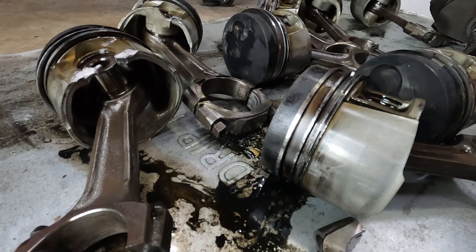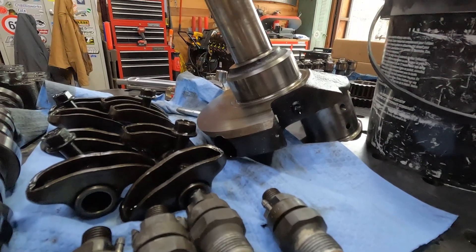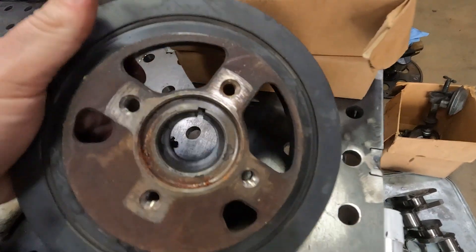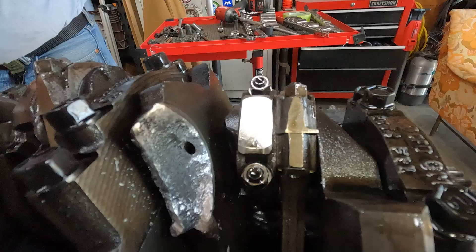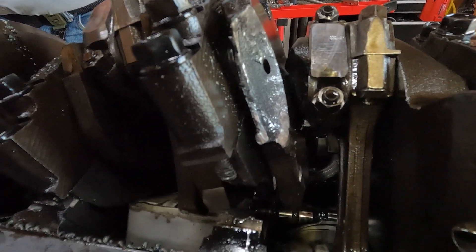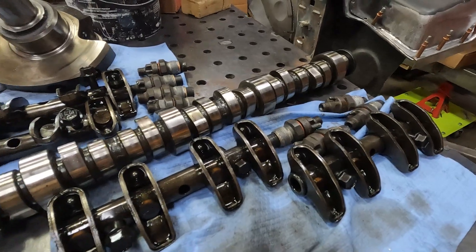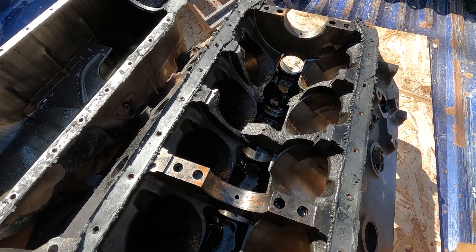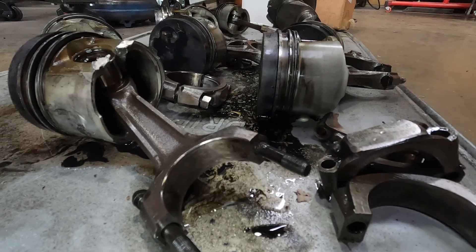All the whole time GM was producing them — from about '82 to 2002 — those were GM engines and they were made with cast crankshafts. A cast crankshaft can be perfectly fine depending on the application. That application does not include diesels with pretty good fuel and torque that have a harmonic balancer that's going out of maintenance. The harmonic balancer broke, and then the crank immediately cracked and created an outer crack on one of the rod mains, then started to polish itself, and eventually just cracked and scattered the block. What's impressive about the carnage is it took two of the main webs with it — ripped out almost half of the block and half of the internals. So the block is not salvageable, not even a little bit.